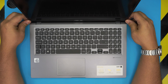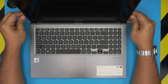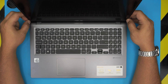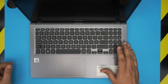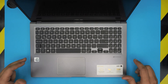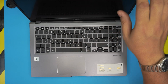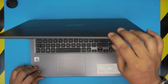Hello everyone, how are you today? I'm back with another video. In today's video we have an ASUS X515JA laptop, and I'm going to show you step by step how you can upgrade the hard drive and the SSD. If you have a low capacity SSD — they do get shipped with a 256GB or sometimes 128GB SSD and a one terabyte physical hard drive — and you want to replace, upgrade, or have both as an SSD, I'll show you how. First, power off the laptop and back up or move your files to your mechanical drive.